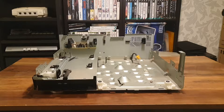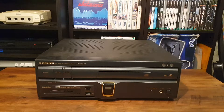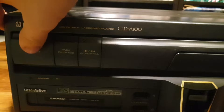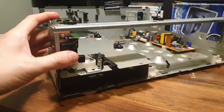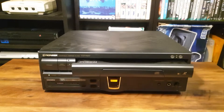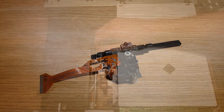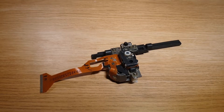Unfortunately that's all I had to show. I would have absolutely loved to have gone back and re-recorded the ending, but as I said before, I no longer have access to the unit, so this just wasn't possible. However, what I can say is that the LaserActive did return to its owner in a much better state. The power button no longer seemed to have any issues, and I was able to change the belt to one that looked practically identical, so the tray has opened reliably ever since. I had also bought a spare laser module if it was needed, but in this case the unit only needed to be cleaned. I gave the new laser module to its owner in case it does fail, so he at least has a replacement part for it. Whilst it was far from the most ideal ending, it was the least negative outcome in the end.